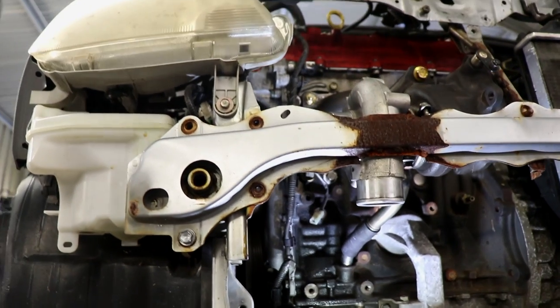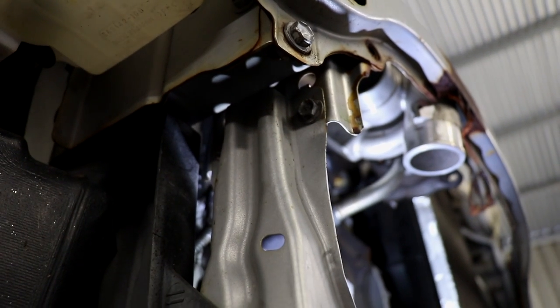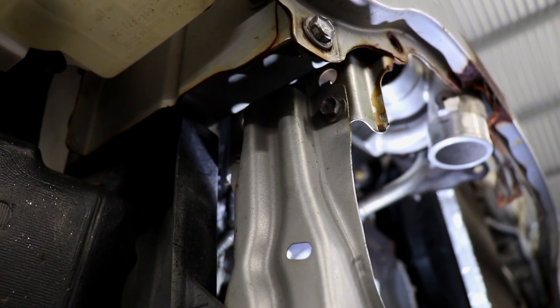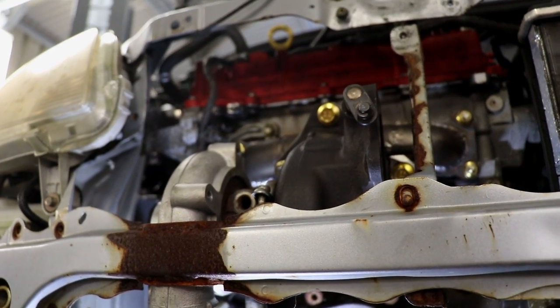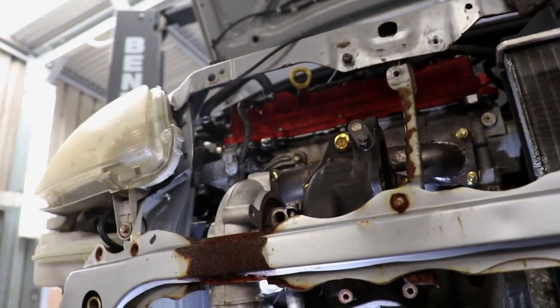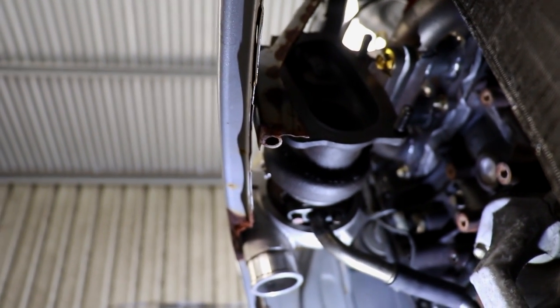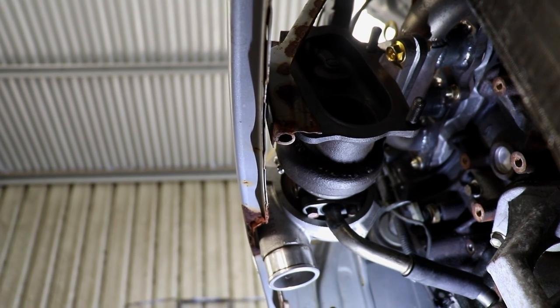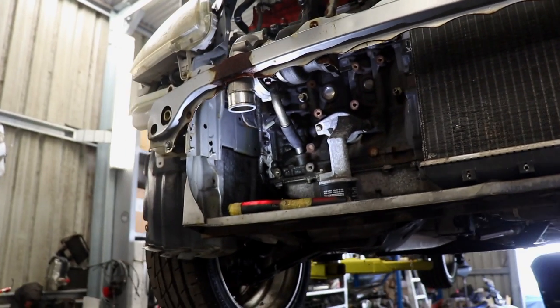You can see where I've previously cut out a clearance for the compressor. I think I'll have to clean all that up and repaint it. I've got the little bracket back on there — that bracket is to support the bonnet latch, so without that the bonnet would probably just fly open because these things are very lightly built. It's a bit of a fiddle to get the dump pipe on there, but usually you just take that bracket off, bolt the dump pipe on and stick it back. It's a very easy car to work on — it's all sort of in your face.